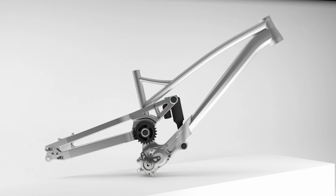Now, they wanted to build the bike to make it future-proof, so there's a few things. There's no weird standards on it. So it's a ZS tapered headset, and it takes a 31.6 dropper post. And interestingly, it takes a 142 single-speed hub out back, not a 148 Boost, because on a 142 single-speed hub the flanges are way further apart anyway, which is one of the goals of 148. So they don't actually need to go that wide. It's post-mount disc, off-the-shelf bearings and fixtures, so if you ruin your bearings, you knacker them, you can get them in any sort of hardware type store.